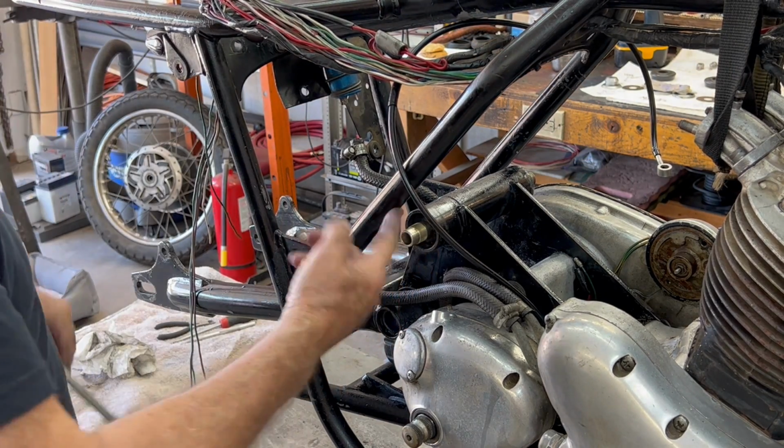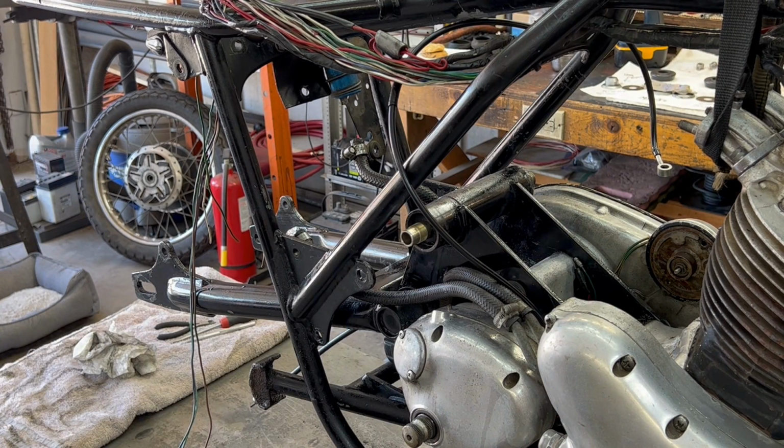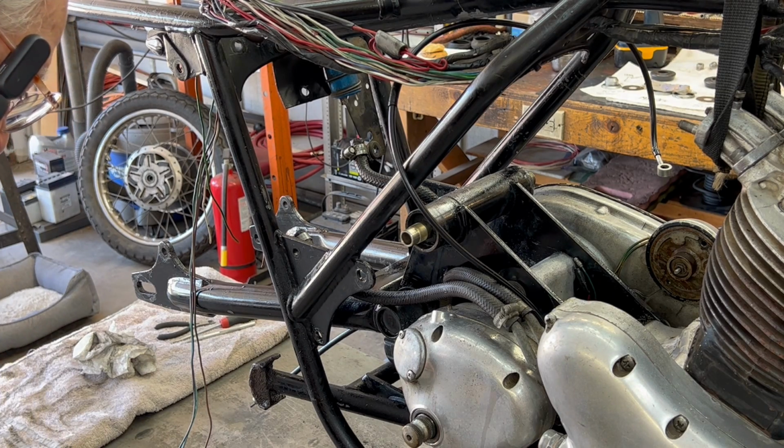But right now the ISOs are in the rear, ISOs are in the front assembly. Tomorrow we will jack and straighten the motor and put the through bolts through on both of those, and we will have changed out the ISOs. So that was fun. Putting all this back together, put it back in my special tools drawer,